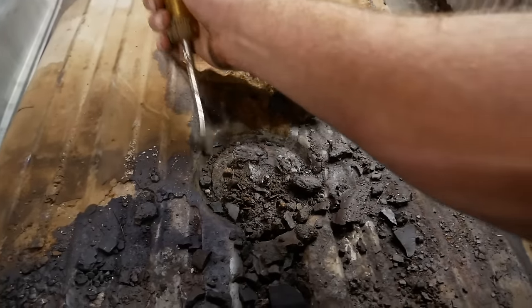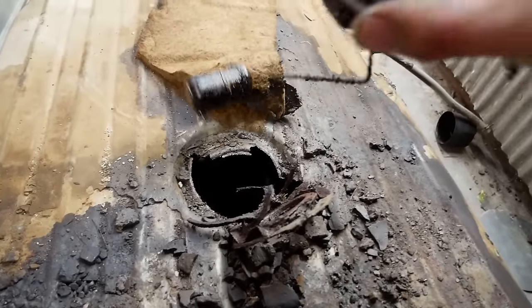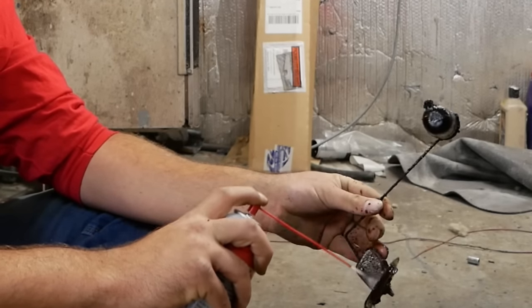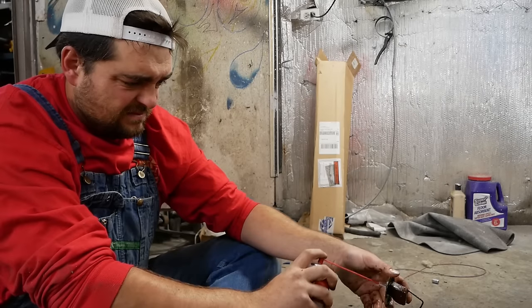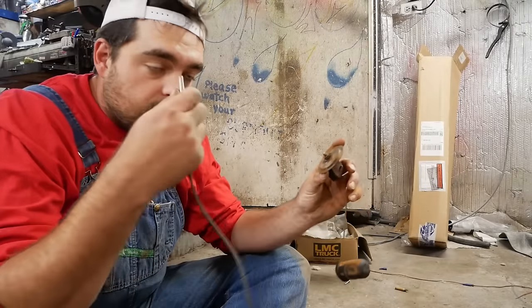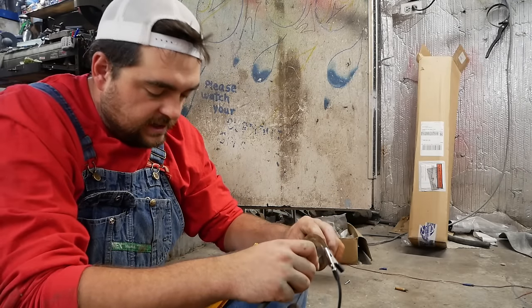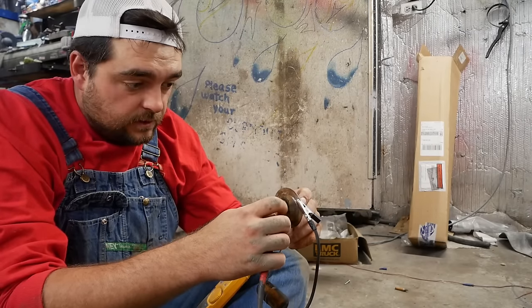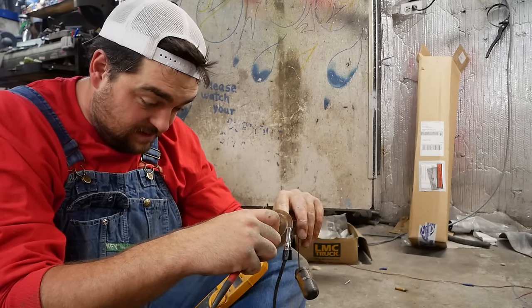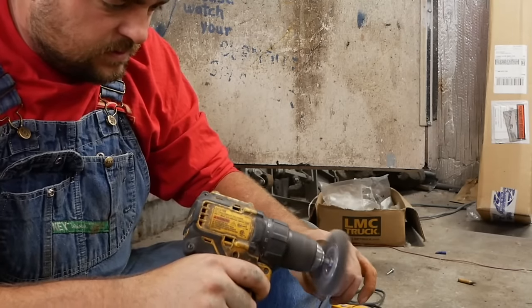I'm not sure what the original looks like, but I'm pretty sure I shouldn't be able to do this. There's the original one — maybe we can clean this and reuse it? After getting it out of the parts washer, it actually looks alright. We should probably check it out with an ohmmeter. I've got my meter here — clamp my alligator clip to the body of the fuel sender, set to check for resistance, and make sure it's got continuity. It does have some continuity, though it's hard to read. I think it might work, and if it doesn't, it'll only be like the 8th or 9th one out here without a functioning fuel gauge. At least it came with the right gasket.